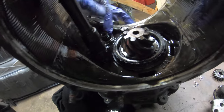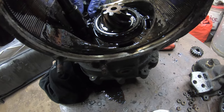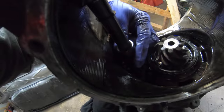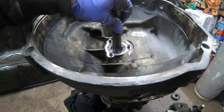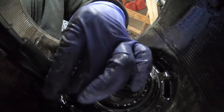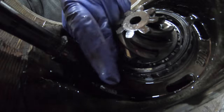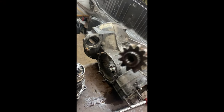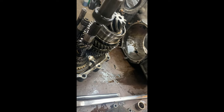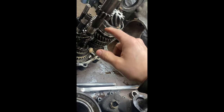To loosen that off — I removed the small gear's snap ring on top, then just used a pry bar slightly and pried underneath it as I spun the shaft, and she came off. I took the snap ring off — you can see I slid it up the shaft. This is quite interesting: this is the input shaft. Power comes in from the clutch here, spins these splines, and then this gear meshes with this one. If you slide this up, you can see they're two separate shafts butted up against each other. This splined gear acts as a sleeve — this is the input shaft of the transmission, and it's actually threaded, so it screws on and becomes one shaft.